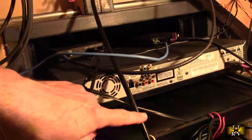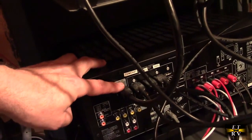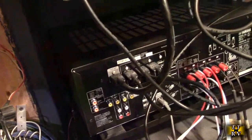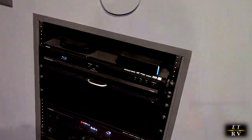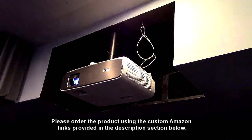Here in the back of my movie theater is where all the cables are. This is the 4K cable I'm replacing — it has some intermittents and goes down to my main receiver and HDMI switcher. The output goes through the wall to my projector. I'm also going to be switching my other cables to this brand because it's just a much better cable. Here on the inside of my movie theater, where the amplifiers and subwoofer shakers are, the Rupro cable now goes into the wall behind the panel, through a tube, and over to my 4K projector.